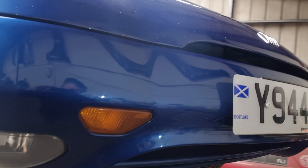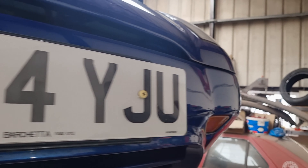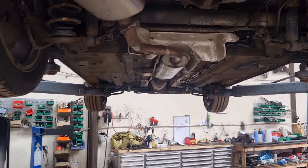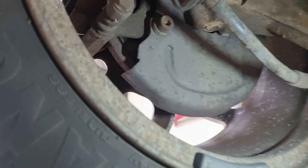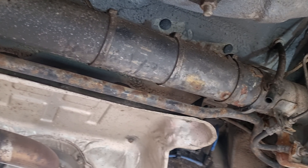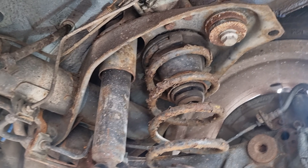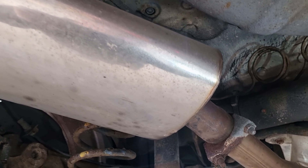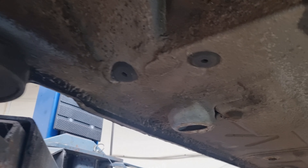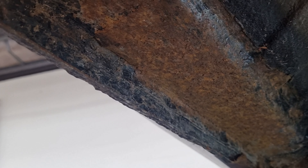There's not much to see on the front bumper — just making sure there's no cracks, because they are very susceptible to having their front end bumped. We're all good. The rear pads and discs have quite a bit of corrosion and a lip to them, so they are going to want changing. The wishbones look as though they're okay without testing them. The rear subframe isn't in too bad a shape — they're normally a lot more rusty than that. The rear legs are okay on both sides. There's a performance exhaust fitted. Let's check the chassis. As you can see where it's had a repair, it's rusting again, so that could do with tidying up.